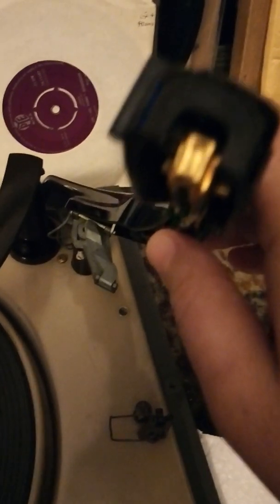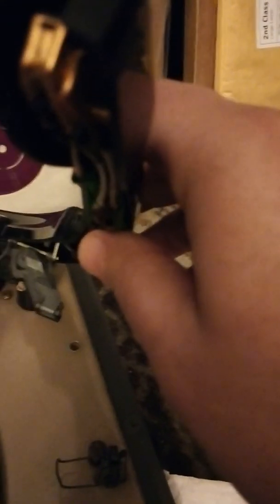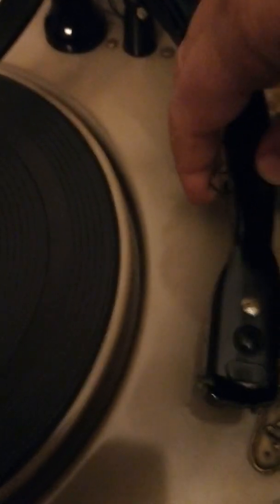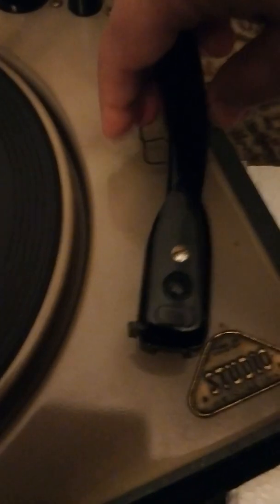You can see it's working — no noise, everything lubricated, beautiful. The cartridge though, it's completely knackered. Look at that — it's completely screwed. I tried to take the stylus off and it fell off broken in my hand. It's a Sonotone cartridge. I don't know who did the wiring — someone rewired it underneath, what a cowboy job. So I'm going to replace all the wires straight from the end of the arm into the deck and put a brand new cartridge on there.